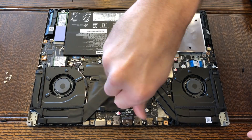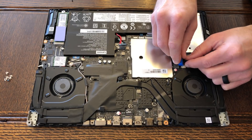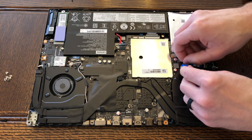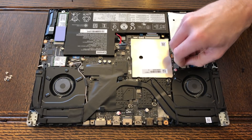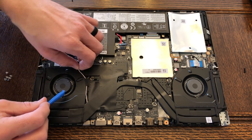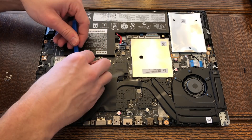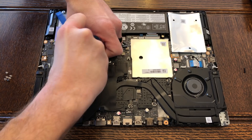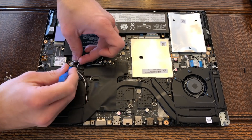The rest came out with relative ease. Removing the fan plugs — just like the battery — assist the wires with your fingers, using your thumbnails and plastic pry tools, whatever it takes to get the job done, but do not damage or pull one of the wires from the plug itself. There's no need to remove the Wi-Fi card or unplug the wires from it, but you will have to remove the wires from the channel that they lay into, attached to the fan.